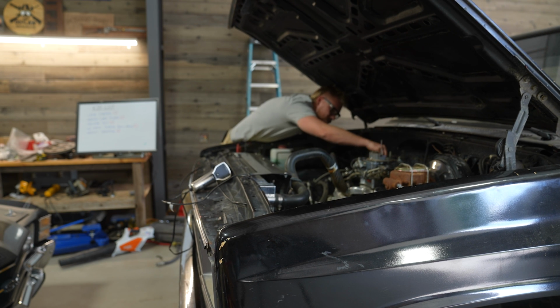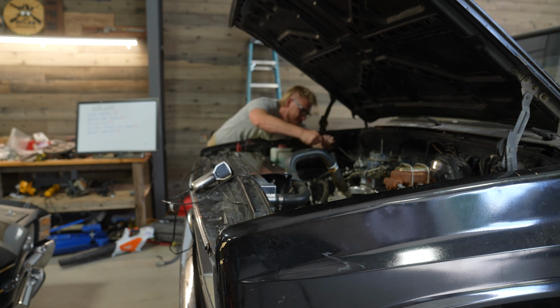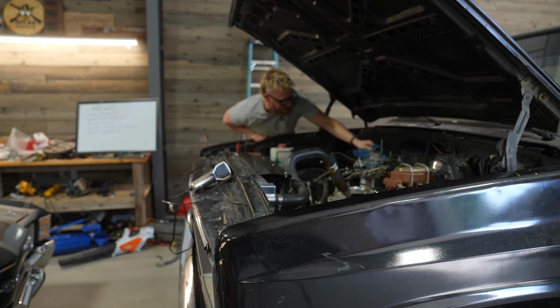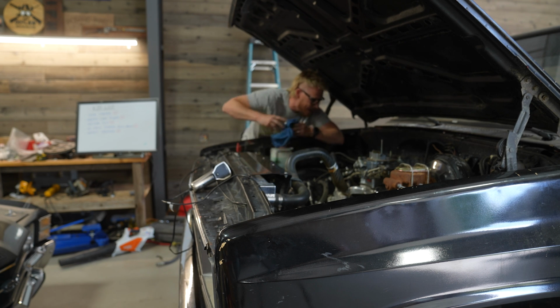Oh, what the heck? How stupid. See if I can put that PCV valve back in. Looks like it's completely shredded. That could have had something to do with my vacuum too. It just came completely out, like it was just resting on top. Oh yeah, look at all those gases too, just coming right out. I like to inhale that. Look at this.